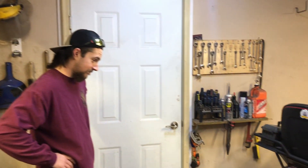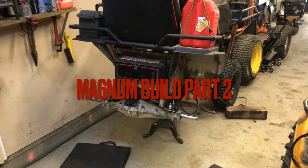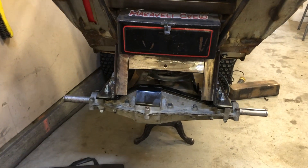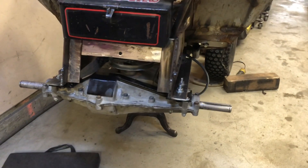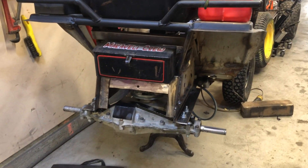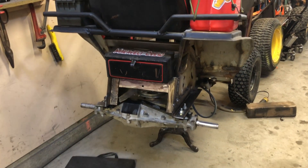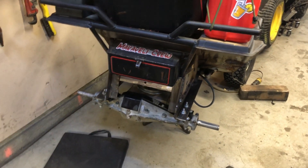Walto? All that bracketry that we made — skid plate isn't on yet but we ended up drilling the holes and we're just going to do a quick measurement of axle shaft to front axle. That should measure out to get our straightness, see if it's all in line with each other.